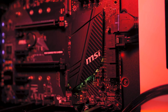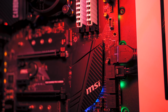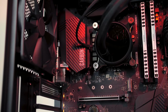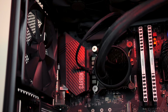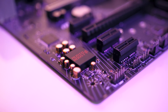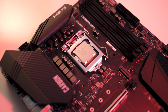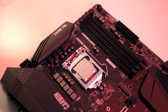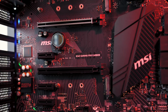You can get some pretty low-end Z370 boards for slightly cheaper than this one. So although I haven't yet seen other B360, H370 or H310 motherboards that will be available, I get the feeling that this one is in a bit of an odd position, and is likely to be one of the more premium options. So if you're looking for that budget board to go with the cheap Coffee Lake CPU, this might not be the best choice for you. However, if you're after some of the bells and whistles without going all out with Z370, then it could be worth considering. In any case, it's great that there's finally more options out there if you're looking at building an Intel 8th gen system, as you no longer have to go with a Z370 board.